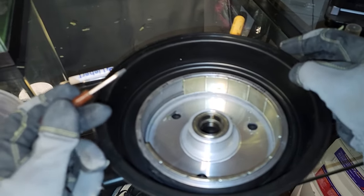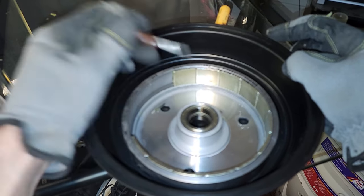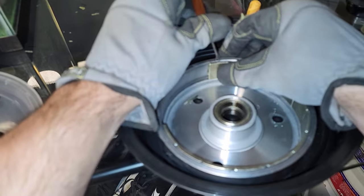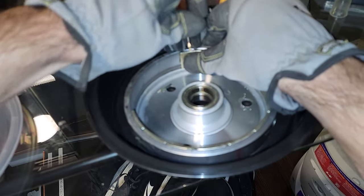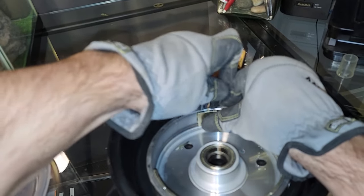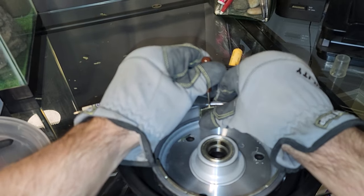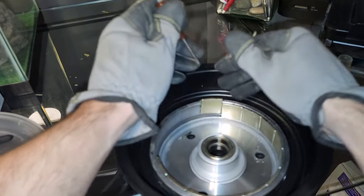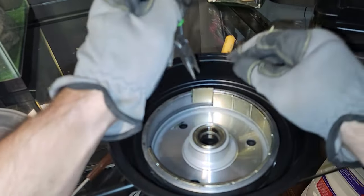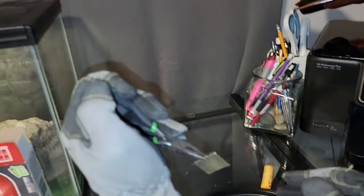Here's how I'm getting them out one at a time. If you can tell how strong they are, look how fast that piece of metal snaps to that. Anyways, we push this little screwdriver, shimmy it behind the loose magnet, maybe like a centimeter down, and then I lever it up, because it's still stuck to the outside of the casing, and then I take some pliers, grab the top, and it slides right out, and there's the magnet.